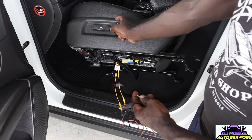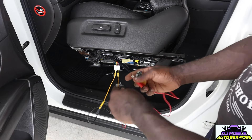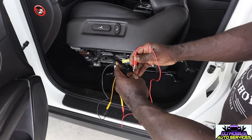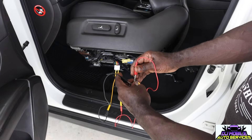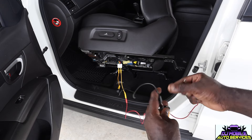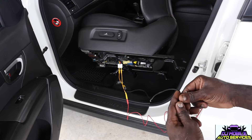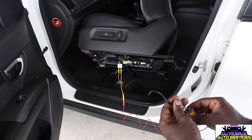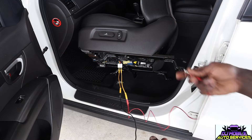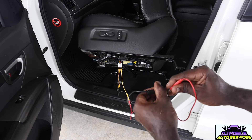The problem was that the switch was not working on the recline. So I'm just going to — that's a 9-volt battery, sorry — and I'm just going to go forward with it. I'm seeing the seat moving. And I wanted to go back, so I'm just going to reverse it. You don't got to use a power probe or anything like that, just a 9-volt battery. Basically it's the disconnect, so I'm not going to hurt anything.